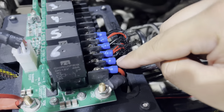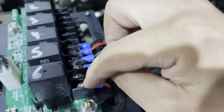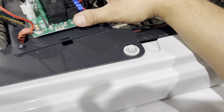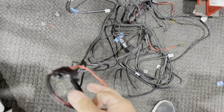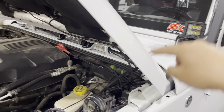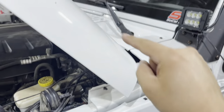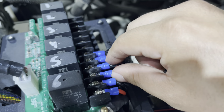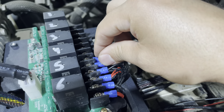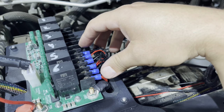This does come with these crimps, which is pretty cool from Rough Country — you don't have to strip your wire; you just slide it in there and crimp these on. You loosen it a few turns, slide it in, and twist them back on. You're going to be getting rid of your regular relay — you no longer need a relay or a separate fuse because there's a fuse built into there. Basically, the power and ground directly from each light gets wired up to this. If you want switch 5 to turn on the front pods, just wire those front pods together. This one has two powers and two grounds because that's a pair of pods.